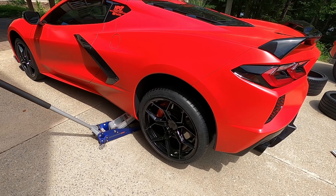The moment of truth — this is the new wheel and the new tire. It's about 11.4 pounds less than the stock one, and it's wider. So these are flow forged wheels; the stock ones are probably just cast, like they were on the C7 Z06. These ones are 12 inches wide in the rear instead of 11, and the tires are 315s instead of 305s, and they look a lot nicer. We're saving 11.4 pounds each — almost 23 pounds in the rear. That's pretty good.